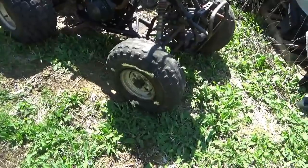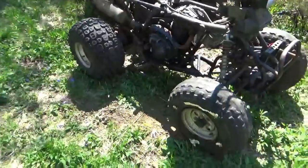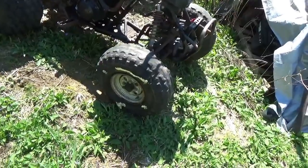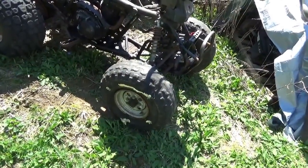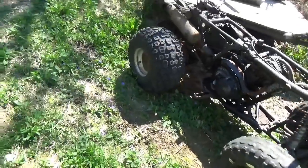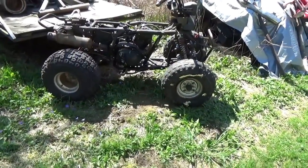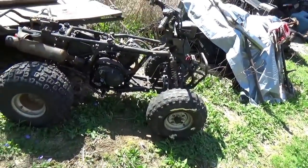If you're really tight on money and you just need a temporary repair, for $12 I got the front tire fixed — costs you $25 for the back. You could do that until it's time to fix it properly. I will warn you that you're going to have to cut the tire off and cut the foam out, so it is going to be a little more work to recycle that rim. Once again, if you're out in the middle of nowhere, your tire goes flat, you can't ride home, and you have some camping equipment — just foam it up and start riding.